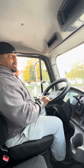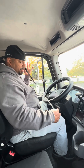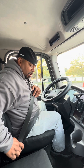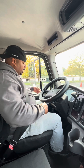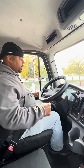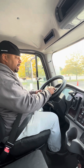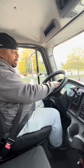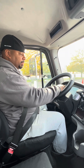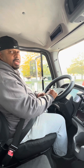Before I do that, when I sit behind the wheel, I'm going to put the seat belt on and inspect it — make sure it's tight and secure, properly mounted, not cracked or frayed, and that it snaps in place. Once I do that, I'll start the vehicle up. The rear wheel is chocked. We allow the air pressure to build up to maximum level. At this point it's already reading 140 PSI. You'll hear the air governor go off in just a second, which will indicate that the tanks are full.